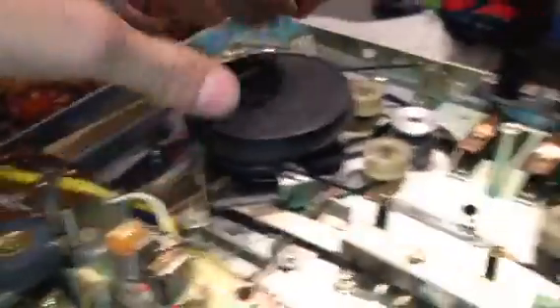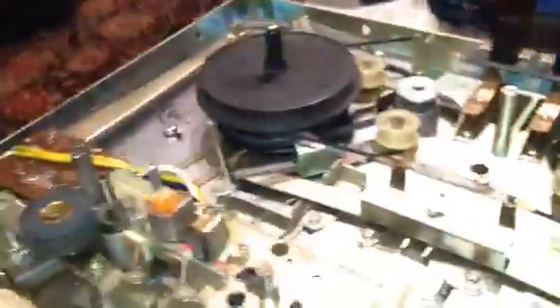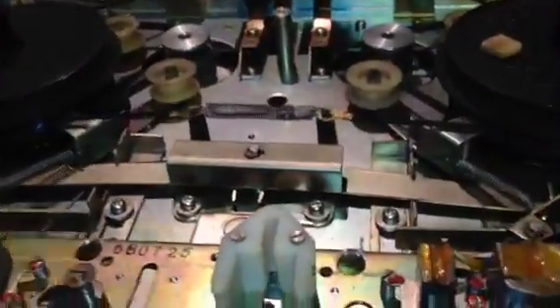There's a long belt that runs down to the tape counter here. Anyway, these belts are tough. I tried to pull on one of them and break it - they are strong, really strong belts. It's cool because when it's disengaged there's no pressure on them at all, just like a Kirby vac - just like they should be. So I'm going to put some - not lithium grease because that gets hard - but some grease on all these pulleys and all these points that move, and clean the contacts and get it back together.